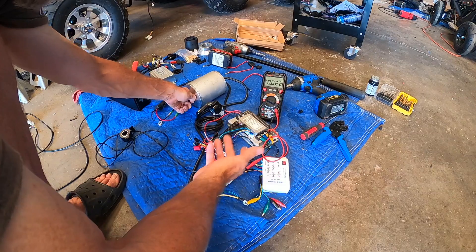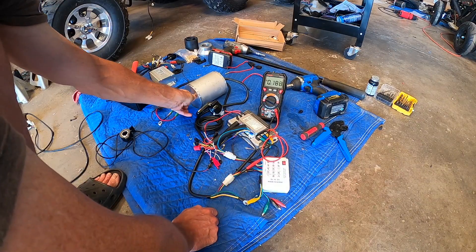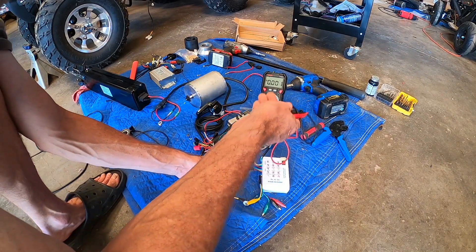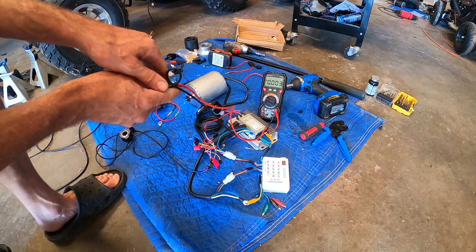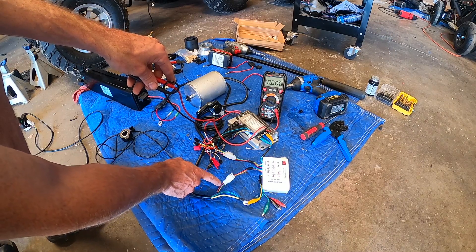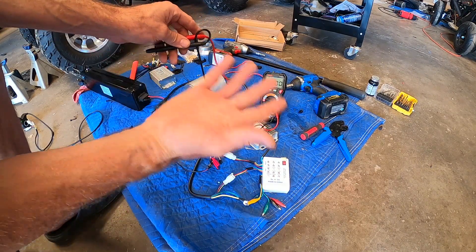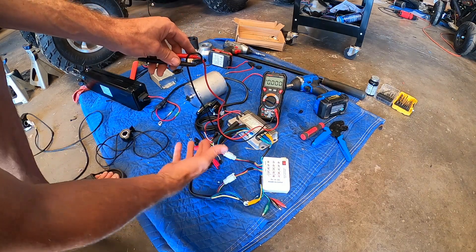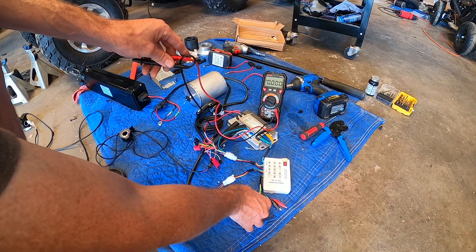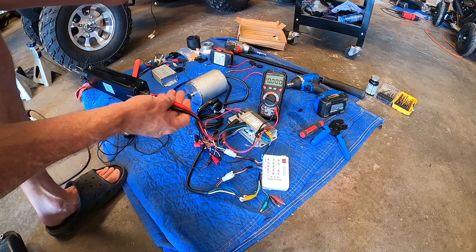The multimeter does the exact same thing - it's just reading voltage return, same as this tool. You can also do a continuity test once everything's unplugged and settled. You should get a different reading between battery negative and each return versus battery positive to each return - something like 5 megaohms versus 25 kilohms, roughly. But that's not a reliable test and only works if your meter is sensitive enough.